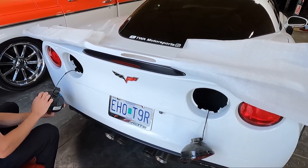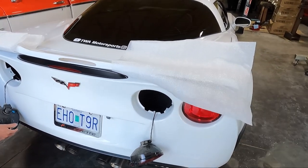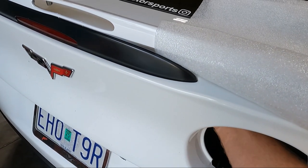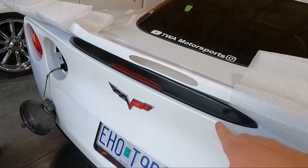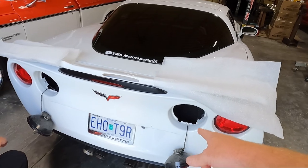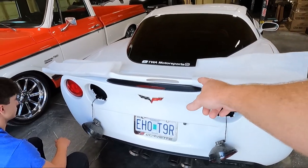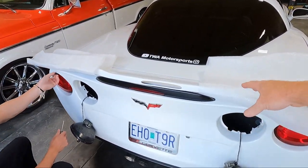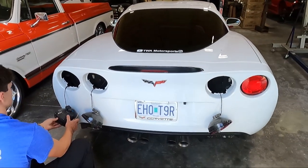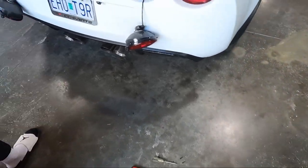You could technically unhook them as well if you wanted to, but I don't think it's necessary. Once we do that, we're going to have to take all four out. There should be a couple of 10 millimeters - should be four of them - that you can reach in and get once you have access with the taillights out. So he'll grab a 10mm, get those loose, and we'll get this old piece out of place. The four 10s hold this thing up.